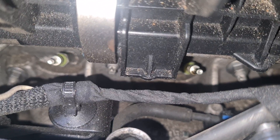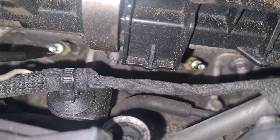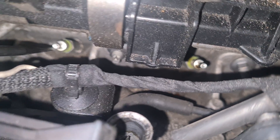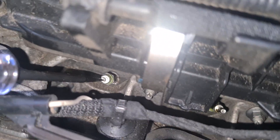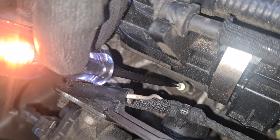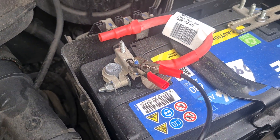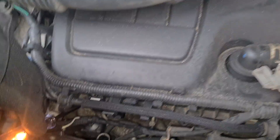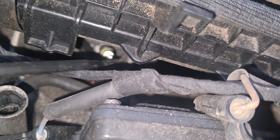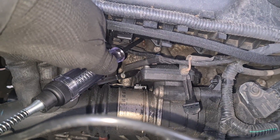You can see we have two glow plugs there with the little yellow rings around them. I'm going to get the light and put it on it. You can see the light is lighting up when you touch the tip of that. What I've got done here is I've got the other end of this onto the positive of the battery, and you can see that that's lit up. Now if we come to glow plug number two and touch the tip — hold it on the tip — we have no light.